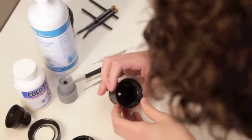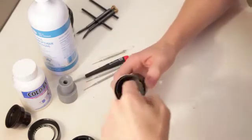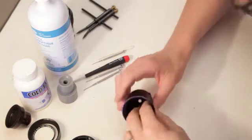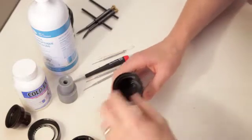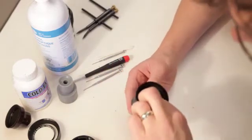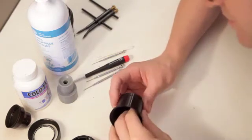Now we're getting close to the aperture. There's oil all around inside there — I got oil all over inside there — but not as much on the aperture blades, though it'll eventually make its way down there. Now that we took that screw out, there's this lever — you can press it down and wiggle it. There's one more ring in there.